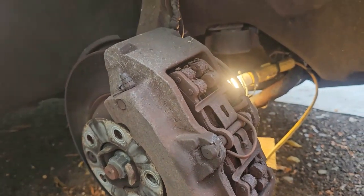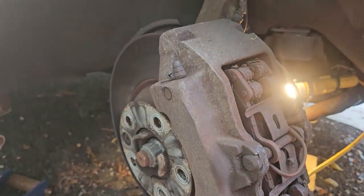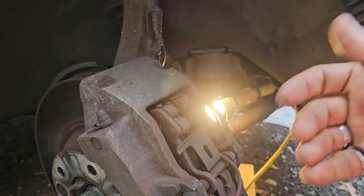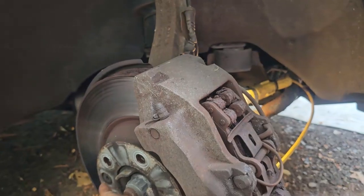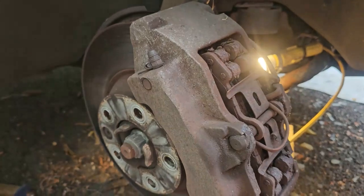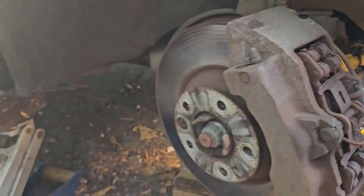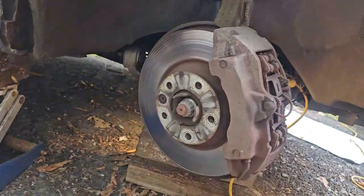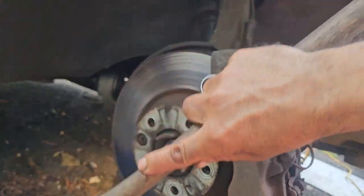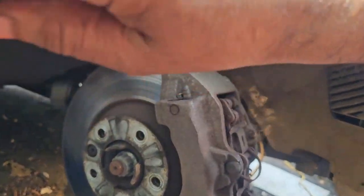It's hard to get out, so just don't worry about it. Once you have this piece out and away, then try to take the rotor out. You'll find it's stuck in there — they're all stuck because of the rust. What you do is tap on this side, here, and tap it pretty hard. That will break the rust.